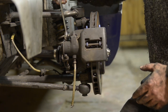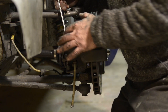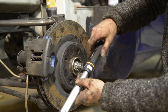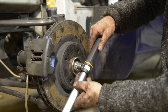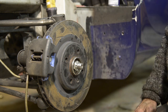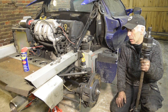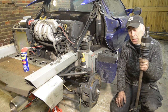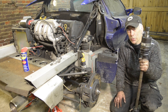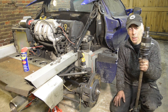I'll put the brakes back on, tie everything down, and we're kind of finished with the work. The last thing is to torque down the nut to 45 Newton meters. Once that's done, we just need to put the split pin in and clean up. That's something for tomorrow — we're all done, the new driveshaft is in. Tomorrow I'll carry on with fixing the brake hoses and bleeding the system. Keep watching, guys, and thank you for viewing — if you have any comments or recommendations please let me know.